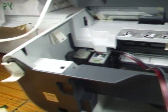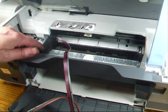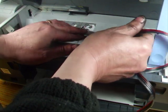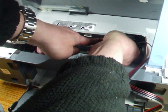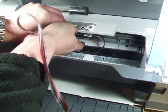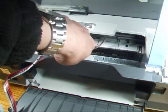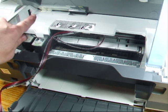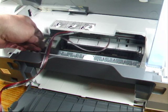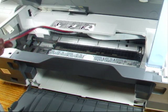We've got to get the piping through those clips. The printer is working now — it's a bit hard to show without blocking it with my arms, but we'll try. With the cartridges in, bring the piping straight across to the right with no twists — going straight across from the cartridges like that. Then curl it back on itself and click it into the clip. The pipe should come from the cartridges, cross to the right, curl up and through that clip, and come back on itself.